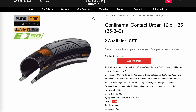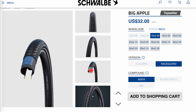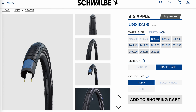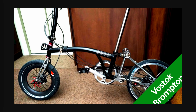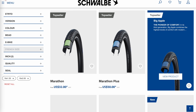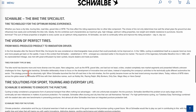To run a tire of the Big Apple's width on a Brompton, you'd definitely have to upgrade the rim to a smaller 305-diameter rim. You may also want to check the rim width specification from the manufacturer. If you want fenders, the stock fenders won't fit — it requires a custom job. The disc brake setup actually makes mounting custom fenders a bit easier since you don't have to worry about the brakes. But expect at least 200 dollars for some classy wooden fenders. This is really the dream commuting tire if you have the rims — but you'd also need to replace the triangle and fork.